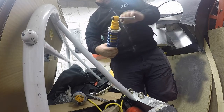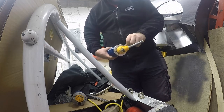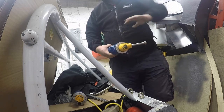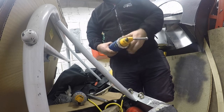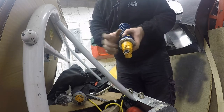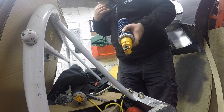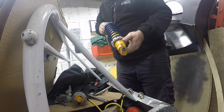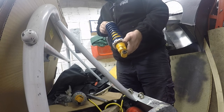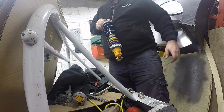There we go, second one done. Just need to make sure when you do this that to get the ride height the same side to side you've got the same number of threads showing at the bottom. Obviously you can do some fine adjustment after that but that's your basic starting point. The other thing we're going to do is set the adjustable damping somewhere in the middle. It's based on the recommendations from Matt at Pro Comp - he reckons at the full extreme of the settings they just won't work properly. So we're going to go in the middle.